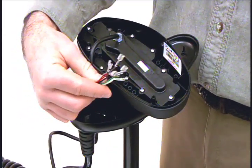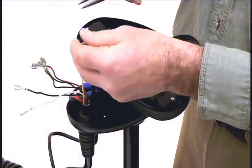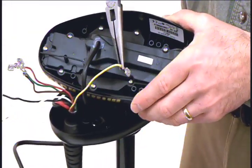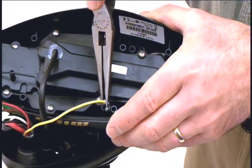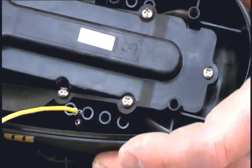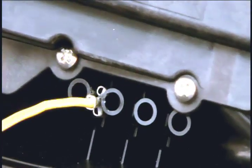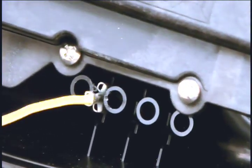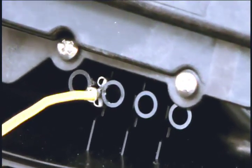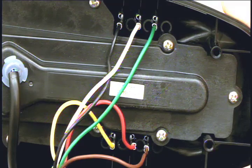The wires that were previously removed now need to be secured. Using a needle-nose pliers, push all six autopilot connectors onto the terminal holders located on the underside of the controller. The wires can go on the holders in any order. Properly securing the terminals is very important to ensure they remain separated and to prevent any electrical short. Here is what it looks like after all six connectors are secured.